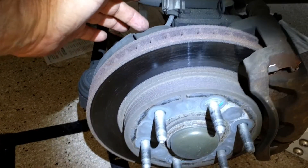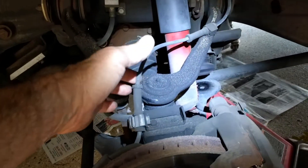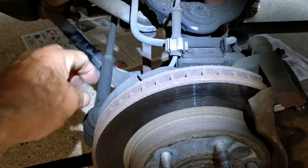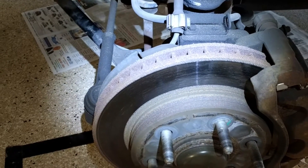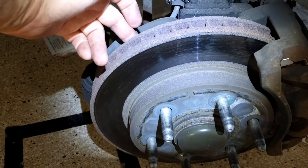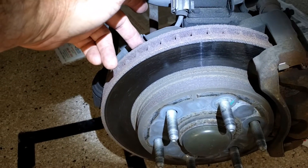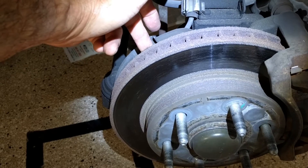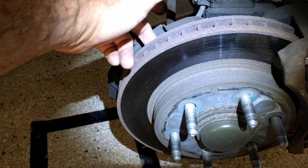The sensor goes to the hub on the front. I don't think this car has rear ABS — I think it has front ABS only. This is the wire that connects the ABS sensor to the module in the car. From my research online, it's often a connection issue where the sensor bolts to the hub — you can't really see it, it's down in there. There's an electrical value that has to be correct, and corrosion — especially in the salt belt states — is a problem. There was actually a recall, but not for all 50 states, just the salt belt states, and it had to do with the connection of the ABS sensor to the hub.